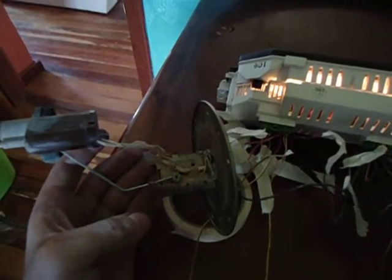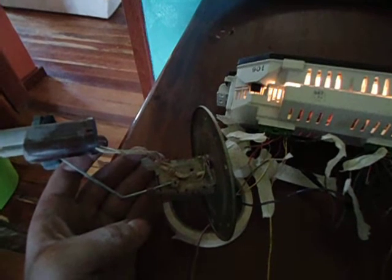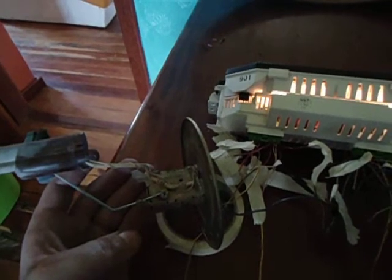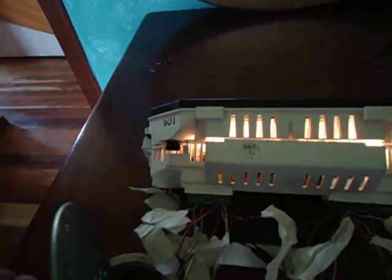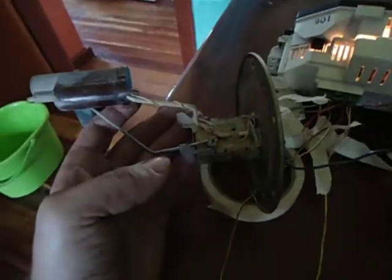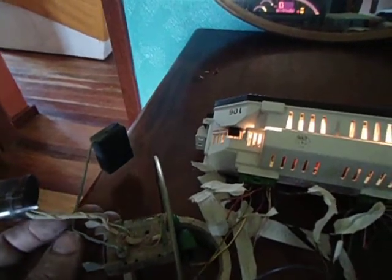We are now making the retrofit for the fuel gauge sender unit from the Mitsubishi Eclipse to make that fuel gauge work properly in the Honda S2000 cluster. When it's empty it must have something like 12 ohms of resistance. We are going to increase the resistance — you can see it's just moving up the fuel level until it reaches the full bar at the top.